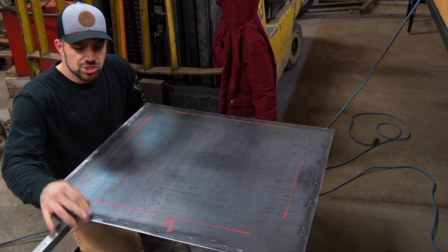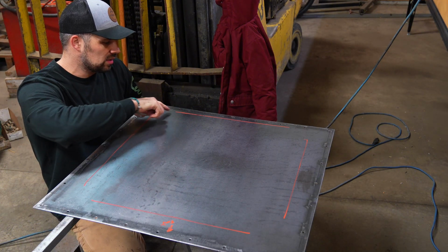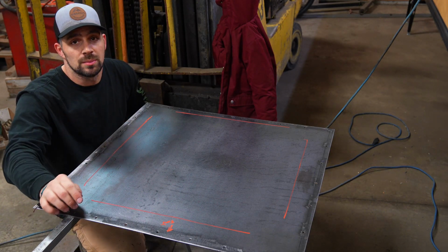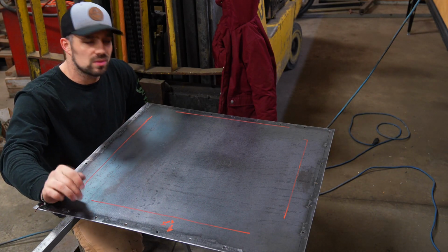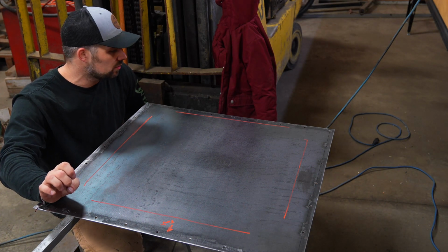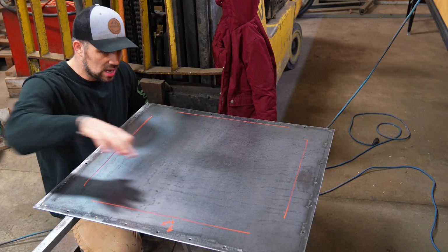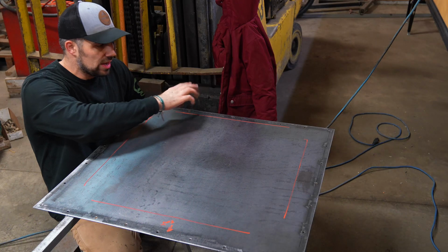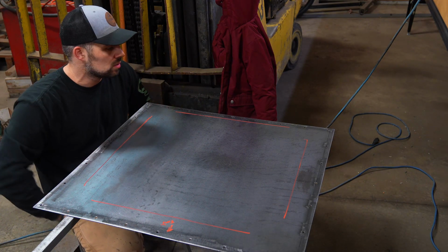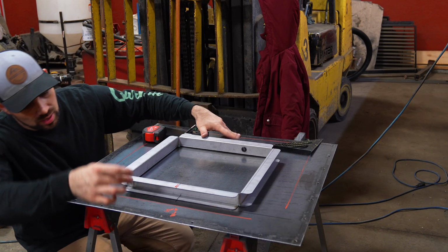So like I tried to show inside the bus, I pulled the panel down, and these are the reference marks that I marked from the old emergency hatch hole. I don't think the hatch was cut square into the roof. I don't know if you could see on the camera, the lines are not square. The edge of the panel was square to the rib though. So I just added an inch to it, and I've got a new line at 4.5.